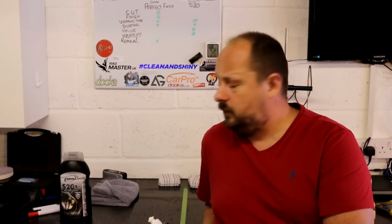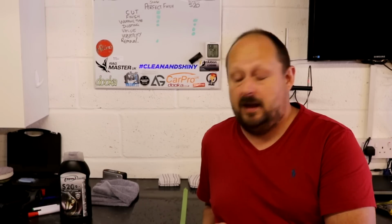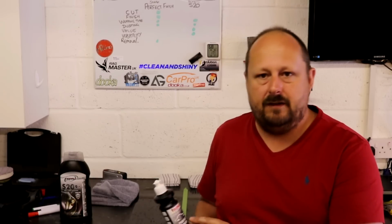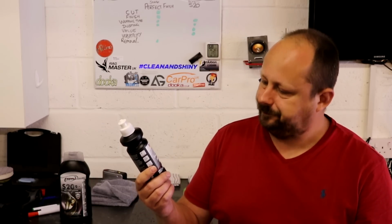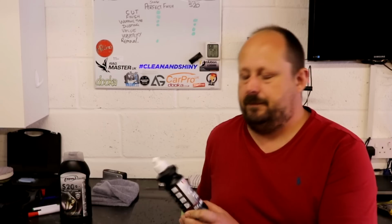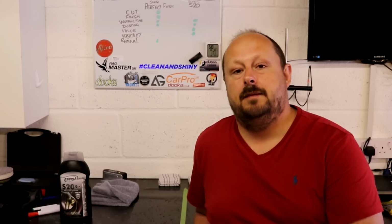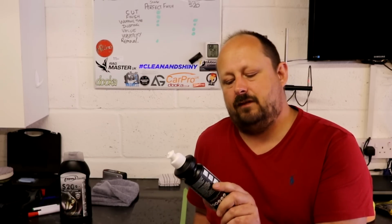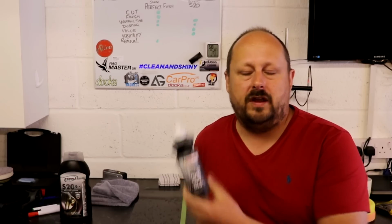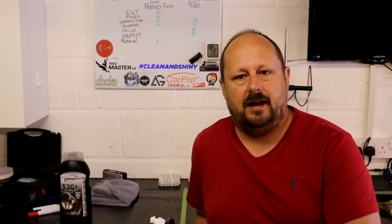It gives a higher level of gloss, I believe, than the S20 Black from the testing that I've done, and a significant increase as well, to the point where there is very little difference between this and a finishing polish. I still think I'm almost tempted to do some more tests. I might do them after I've shot this video, but I think this is getting up there with the level of finish that a finishing polish can deliver you. So that's one of the biggest cool things about it. But the other cool thing about it is how quickly it gets you there.